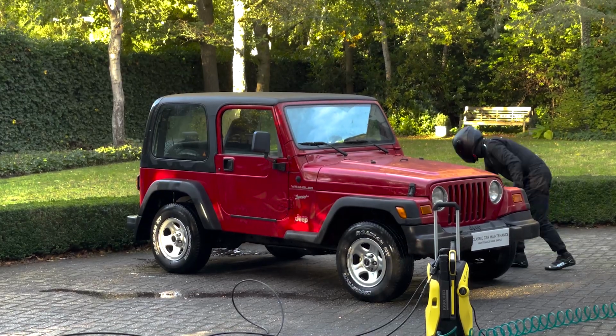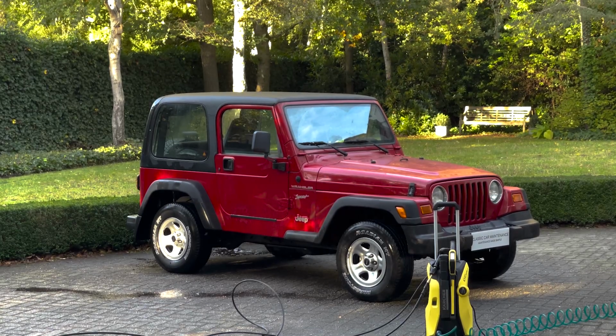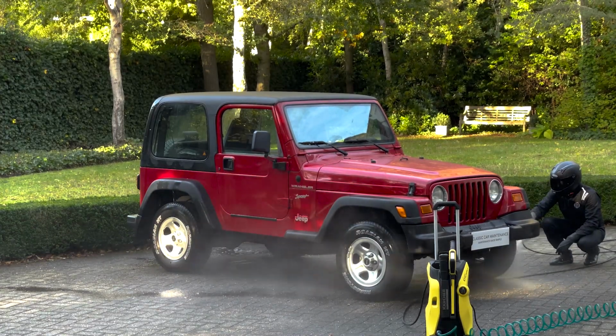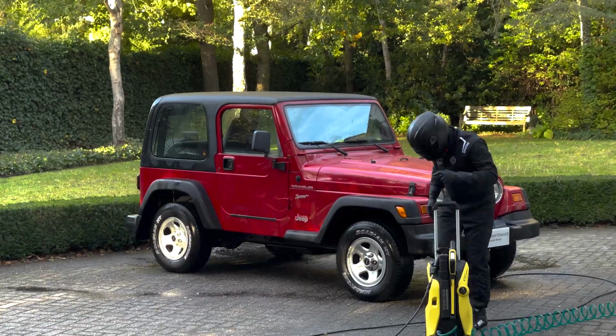After you've worked the product with your wheel brush and woolly, rinse your wheels with your pressure washer to get all of the product off. You don't want to leave any on there because it might etch your wheel coating if you do. Now that you've washed and rinsed your wheels and tires, it's time to do the rest of your car.